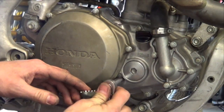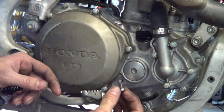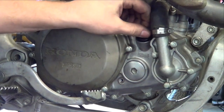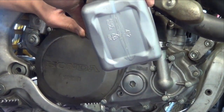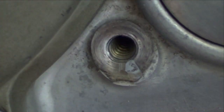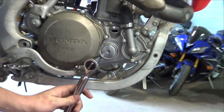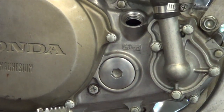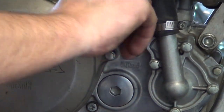For the transmission, first remove the oil level check hole. Remove the transmission filler cap and use only approved wet clutch compatible motorcycle transmission oil. Slowly add oil until it comes out the check hole. Reinstall the check bolt with the new sealing washer and torque to 10 Nm. Be sure to clean the filler cap and install a new O-ring.